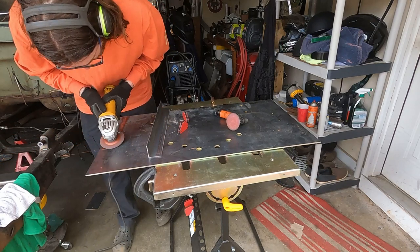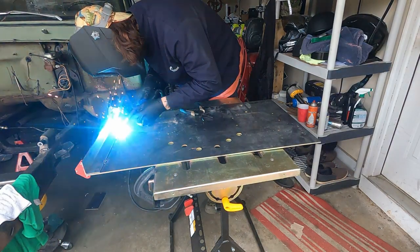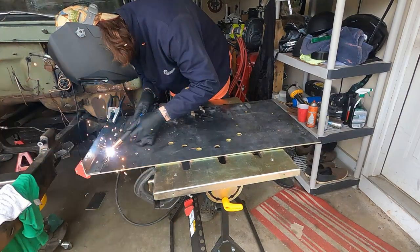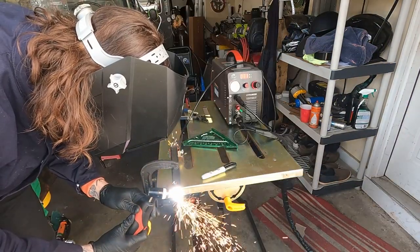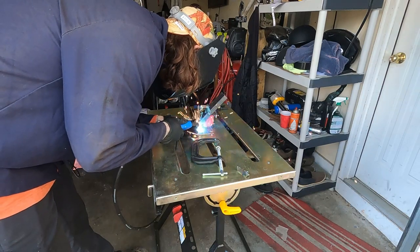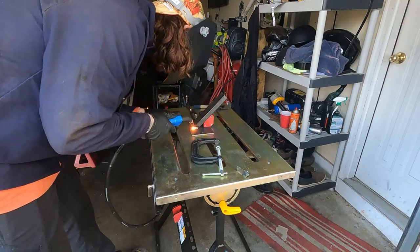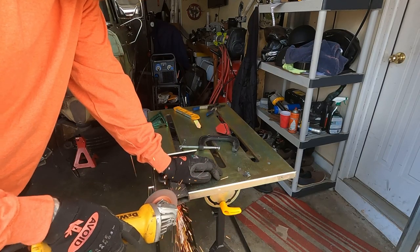I also put 2-inch angle iron on the bottom to kind of stand it off, so when I set it in the bed, the whole setup is then just resting on the air lines that come into the bottom. I made this mount that you see me making here for my manifold, and next we're gonna bend up some hard lines and put those from the bulkhead fittings to the manifold.